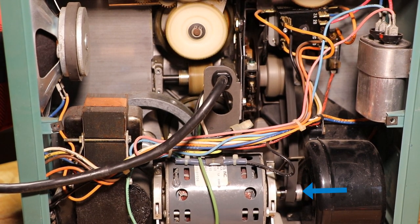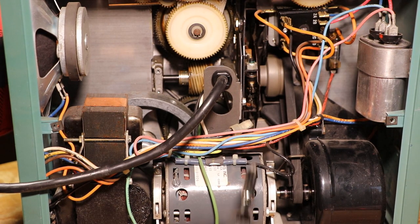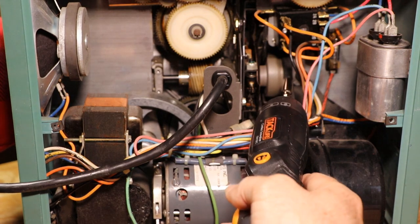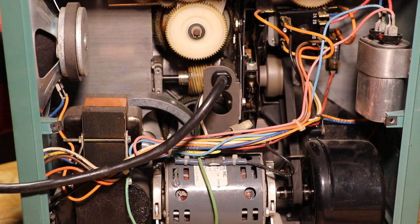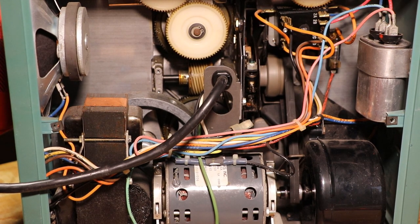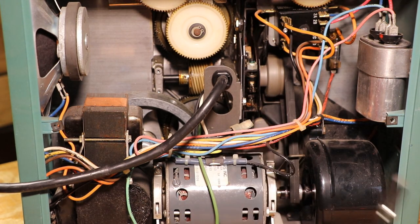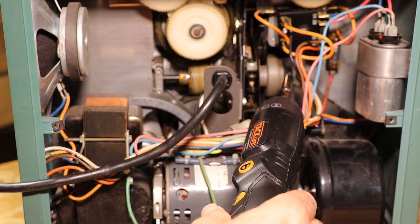Every time — it's because the belt is worn out, it's slick on the inside, which I'll show later. A lot of times it'll slip right off the top motor pulley, but this one hasn't done that yet — it's trying though. That belt is toast. So our goal is to switch out the motor drive belt. This end is on the motor, that end is on the shuttle pulley.